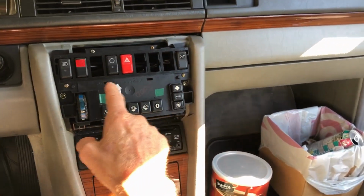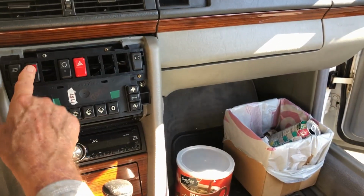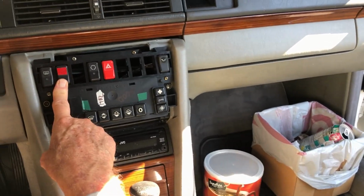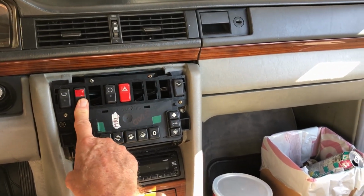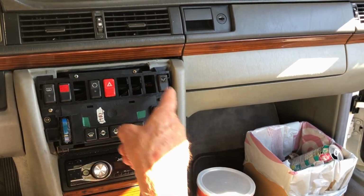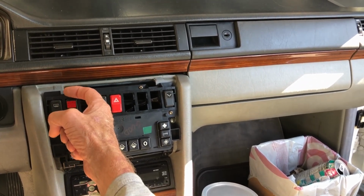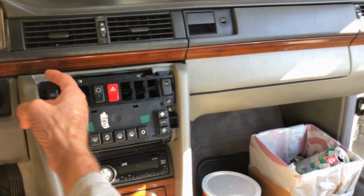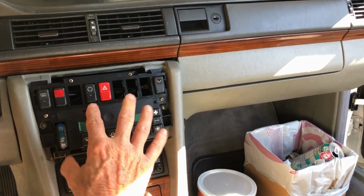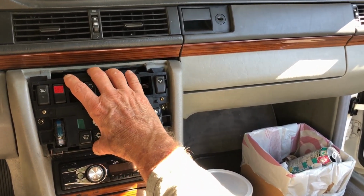Yeah, this is one of the used climate control units. This is that high-speed fan switch hack. I was able to get the fans to work by putting in a switch, bypassing this whole unit, and it basically applies a ground signal to the wire that comes out of this unit. It's called the trigger wire for the high speed relay.